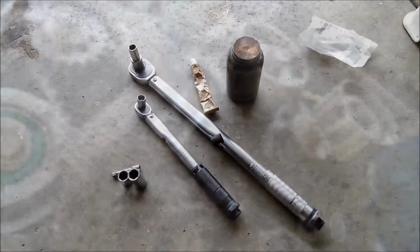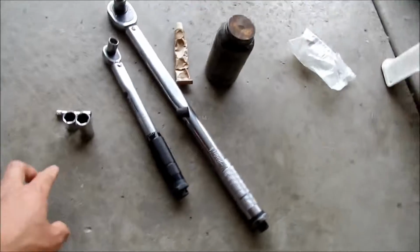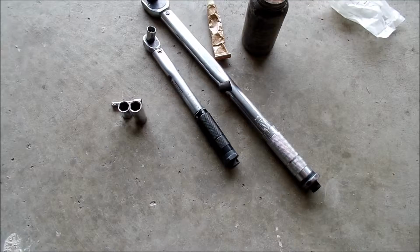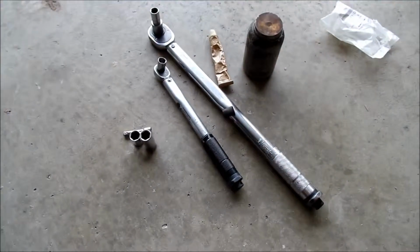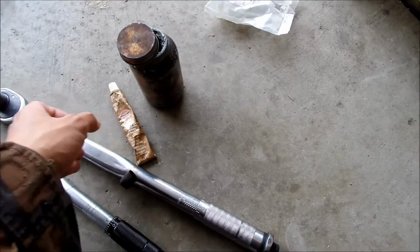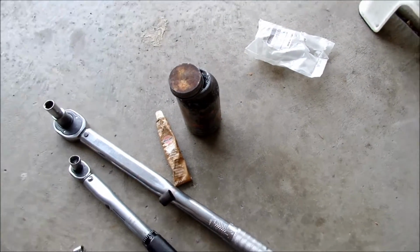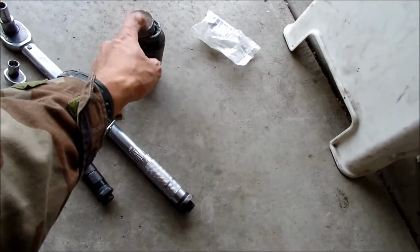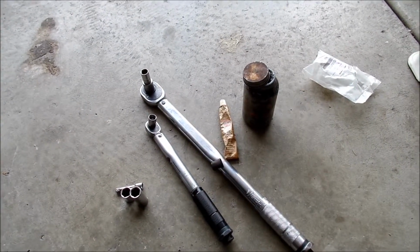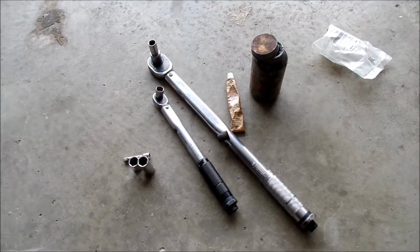Okay, so the main tools I'm gonna be using today are some 14s, some 12s that are already on there, and I don't have 14s for the little guy though. And anti-seize compound for the not so hot stuff, and then the copper anti-seize compound for the hot stuff. So all on the exhaust stuff I'm gonna put the copper stuff, and then on the intake stuff I will just use the aluminum stuff. Like, you really should just put that on all your bolts, because you don't want them to snap when they come off. But all the ones have been pretty good on this engine, so.